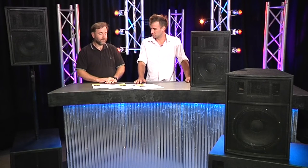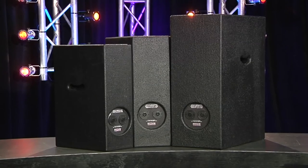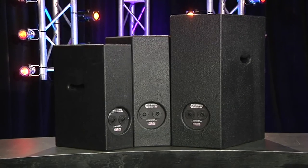The subs are bandpass designed, so you can run them full range and they will naturally roll off. You can also cross them over actively. Ideally you would run an active crossover, but the bandpass box allows you to just jump from the sub up to the full range box and get surprisingly good results. So if you're shy for amp channels, it's a good option.